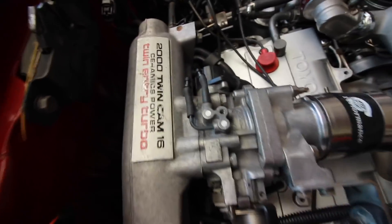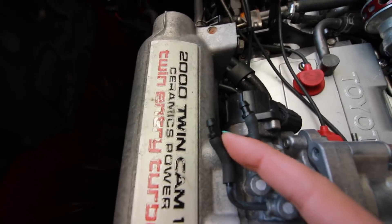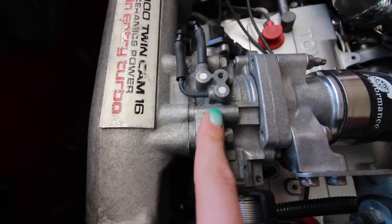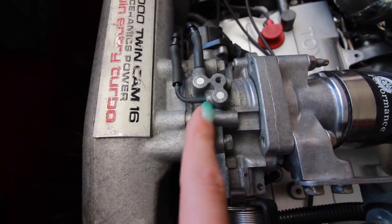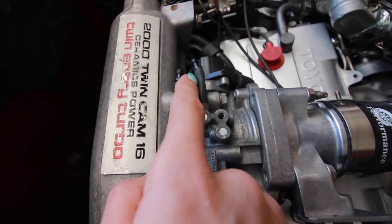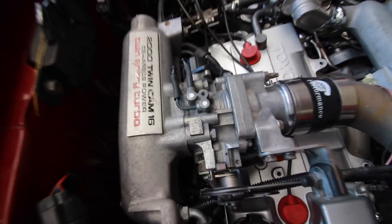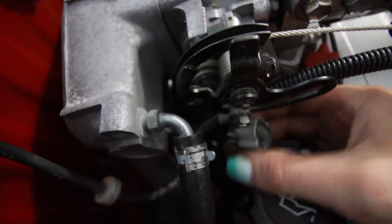Right before I brought Dave to the airport, he had one more idea: adjust the timing on the distributor. He loosened it and I'd start the car while he slowly moved it back and forth, but that didn't quite fix the problem. What did fix it was this vacuum line right here. When I first got the car it was completely looped, bypassing the throttle body — basically a vacuum on either side of the throttle body, causing a weird vacuum issue. We cut the line and capped both ends with irrigation caps, and now the car actually idles. The idle air control valve is still bad and doesn't get 12 volts, but the car still idles.